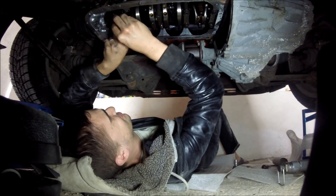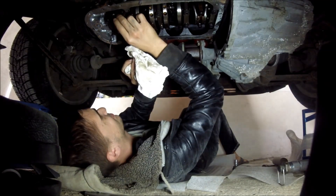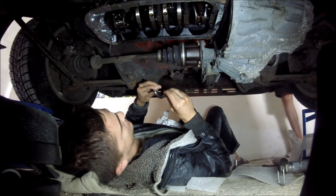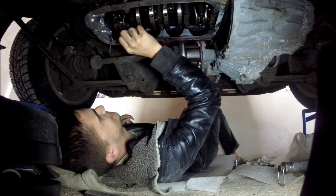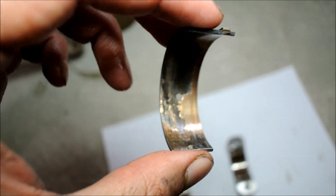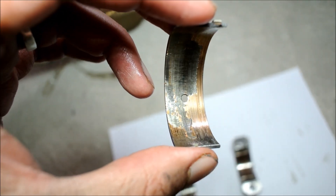When you remove your bearing caps you can take a nice look at your rod bearings. This is the actual true test of how your engine is doing - how good are your rod bearings and whether you have rod knock. Here comes the moment of truth for my engine. This was a very sad moment for me because my rod bearings looked pretty horrible. I'm touching the rod journals to see if there's damage, and here's a shot of my rod bearings - this is a horror story.